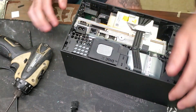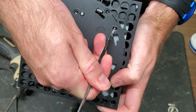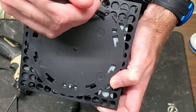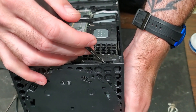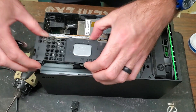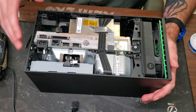To get this piece off, there is a little tab right up in here. You just want to push up on that until it starts moving, then come in here and push up. Once we get to a certain point there's a little opening right here and we just pry that up. Now we can pull this out, which gives us access to pull out the disk drive.